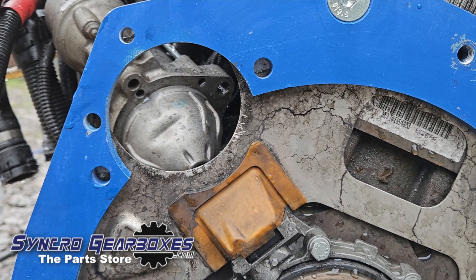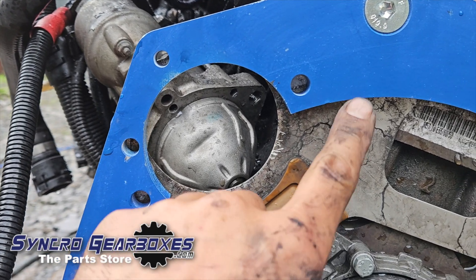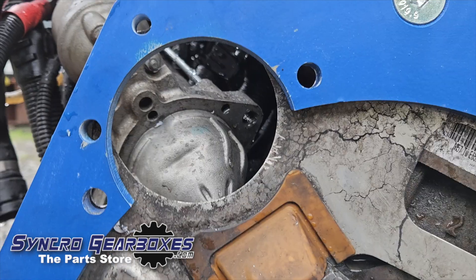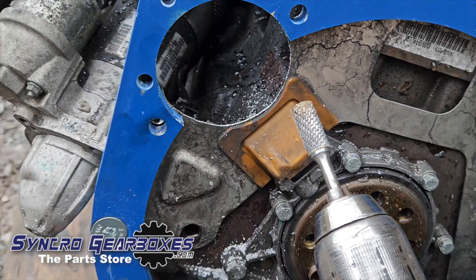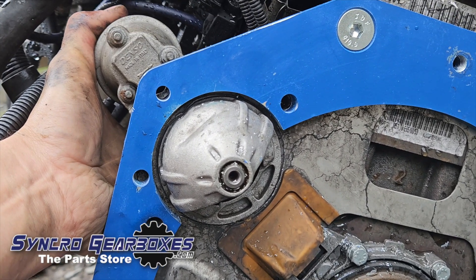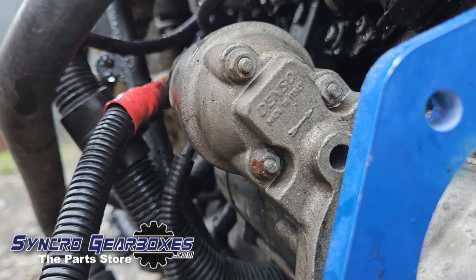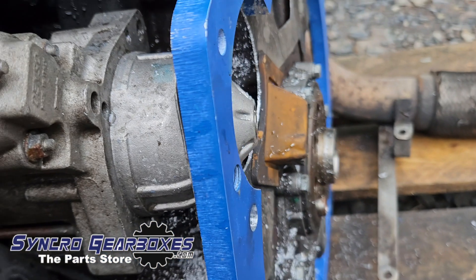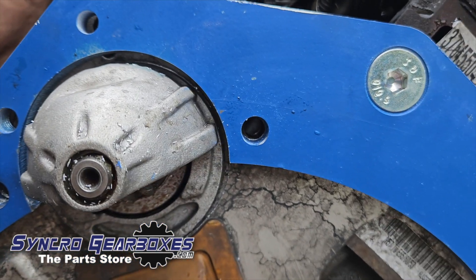Next, open out the dust shield hole and drill out the two main bolt holes. If you've got the earlier M57, the dust shield will already be in the correct place so you can skip this step. Then use a die grinder with a carbide tip to reshape the hole so the starter motor fits back in — grind that bit of aluminium out. Then cut out the section of the dust shield where the dowel goes, since it's now in a different position.